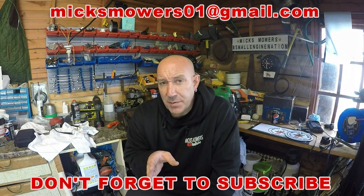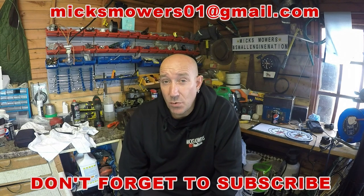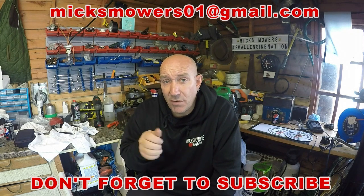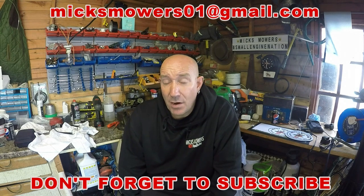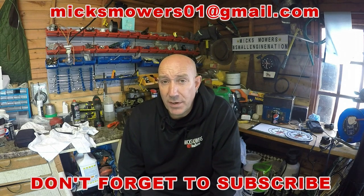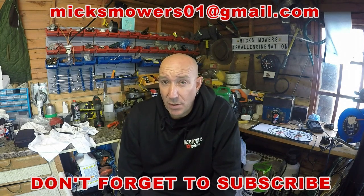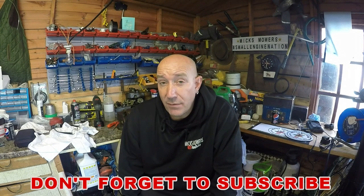We're going to look at this Marksman. On my live stream just the other day, some of you guys wanted to see me try and get it unseized, and it turned out it wasn't seized at all. I think it's just gummed up pretty much. It's been sat for so long — I was able just to move the flywheel ever so slightly with a screwdriver and it freed itself. I put some petrol down the head and it actually fired, but I can't get any fuel to come down through the carburettor. So I'll get it up on the bench, get the carburettor off, have a look at what we can do, and see if this little generator will run. Hopefully we'll actually power something up, which will be quite cool. It's a two-stroke Jenny, 50 to 1 mix, and it should be quite good if I'm getting it to run. So without further ado, let's get down and dirty and let's check out this Marksman generator.